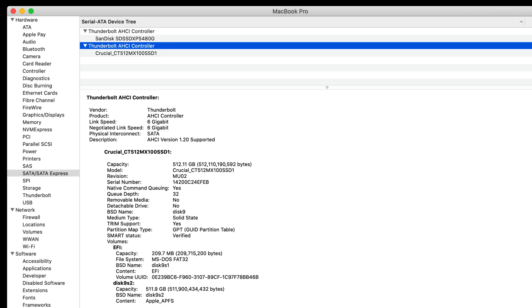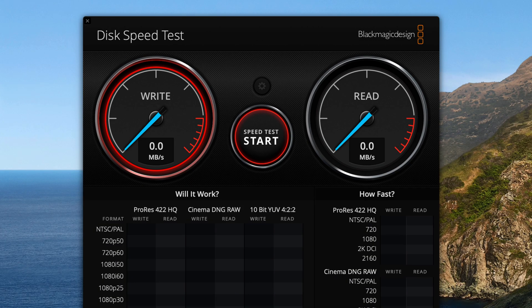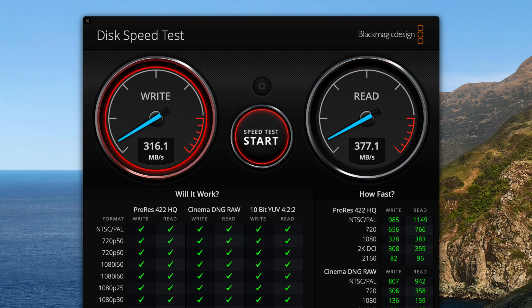You can see that the MyBook is just presenting the SATA interface directly to macOS, so we can see the actual SSD underneath, which is pretty cool. Let's talk performance. Unfortunately I didn't record how fast the internal hard drive was before I got rid of it, which is a shame. But here is a mechanical hard drive that is probably slightly more high-performance than Apple would have included. Bear in mind this is reading and writing one contiguous file — the actual performance using it for an operating system would decrease because of all the little files spread around. Comparing this to the new boot volume using the MyBook, the numbers are a lot better — at least three times faster, sometimes four depending on workload.